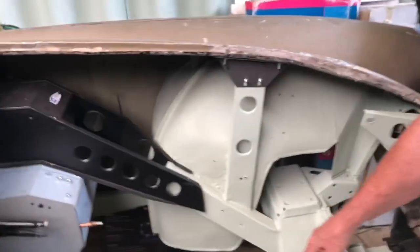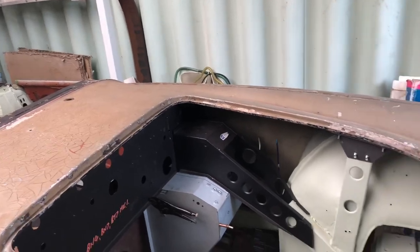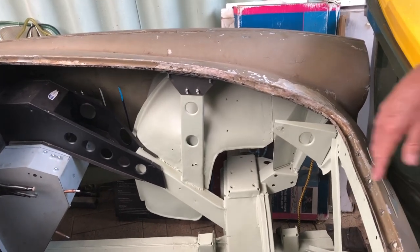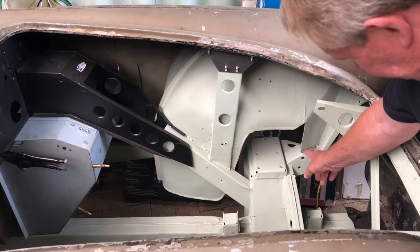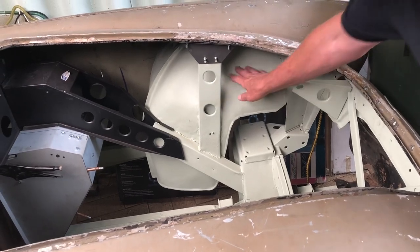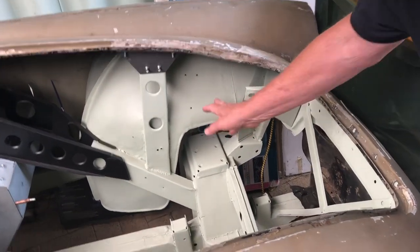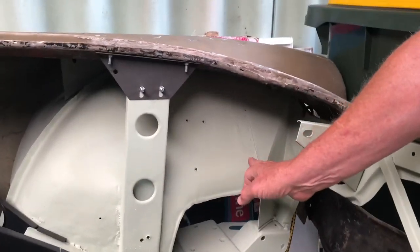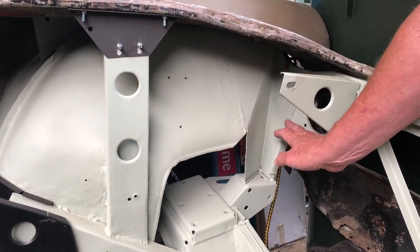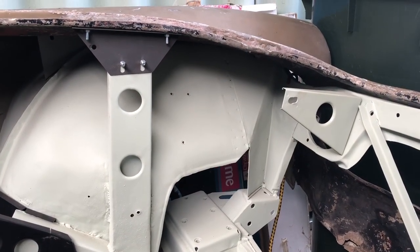I should probably have re-welded it. Was that the one where Len lost a tire or something? He lost a wheel from the back — the back certainly lost a wheel. He's gone back to disc wheels, not spokes. So I had to — I couldn't get this lined up. I had to put a little spacer under here, a packing piece to get this to fit in the right place. So it has had something happen there, but it wasn't a serious one because this shape is still quite good. The other thing is — with this dry country car — everyone I've seen has got rust between there. Mine — I had to replace that. You can buy these from Kilmartin quite easily, this front piece. But because there's no water, it hasn't rusted. So the rust on this one was only where the water had collected.